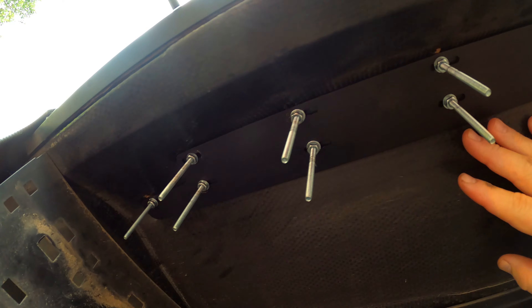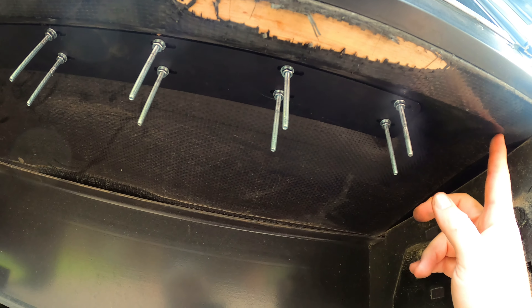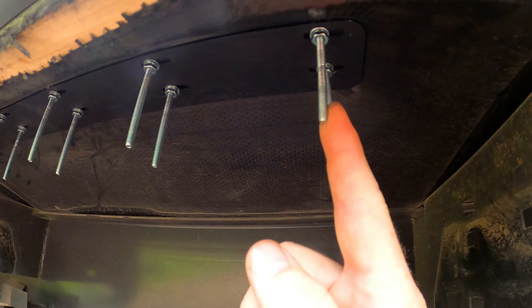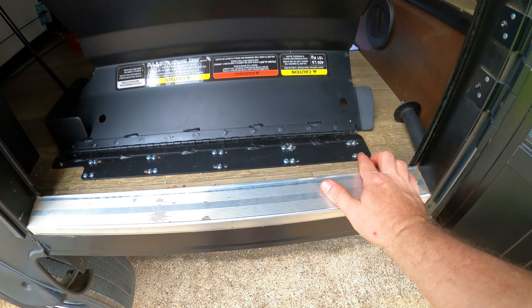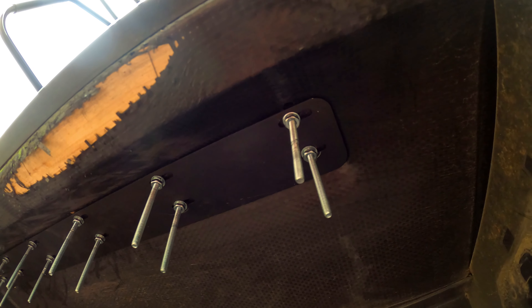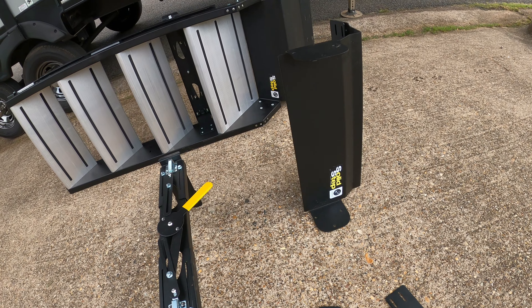What happened when I tried to install the long machine screws with the bottom plate was that the bottom plate pushed the underbelly material up and even split the material along the edge — I'll have to repair my underbelly at a later time. If you see the underbelly material starting to get deformed or distorted by the machine screws and bottom plate, stop before you damage your underbelly and just use the wood screws. In my case, the wood screws were more than sufficient for securing my steps to my fifth wheel. Also, if you do end up using the machine screws and bottom plate, you will need some bolt cutters to cut off the excess screws, especially if you're planning on installing the Lippert storage box after your steps are in place.